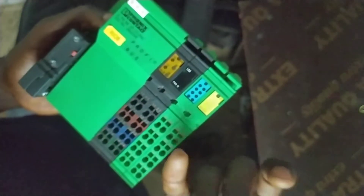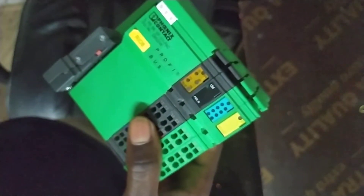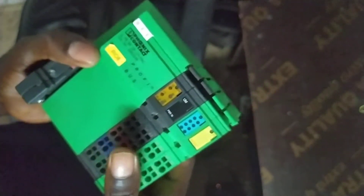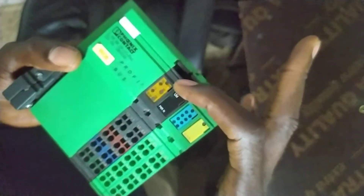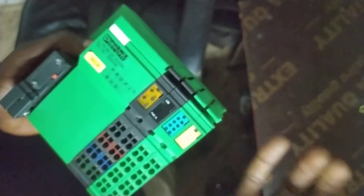When you put it back and the power comes in, it is possible the fault clears — no red light — and you can start using the system. But it is also possible you put it back and the fault still persists. If the fault still persists, you have to look deeper unit by unit to identify which one is faulty.